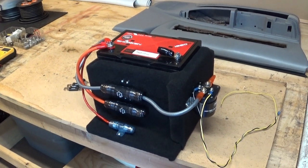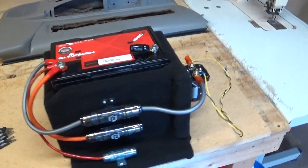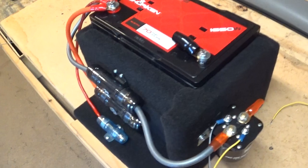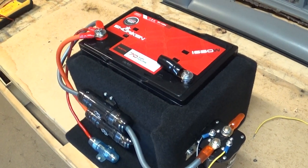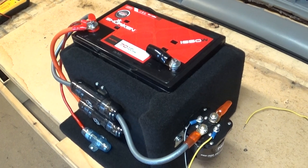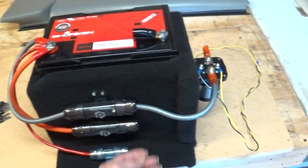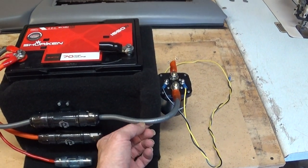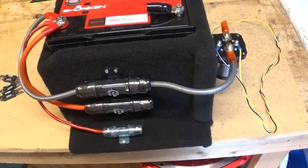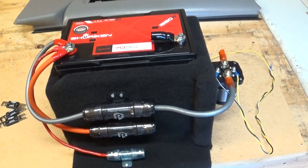Looks like I made a bomb second battery to go in the Impala, it's going into the trunk. Thought I'd give a quick tip for anyone adding spare batteries. First of all, they need to be fused on both ends. I've got the car wired with gray solid copper 4 gauge - don't use the aluminum stuff, especially if you're doing high current.